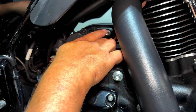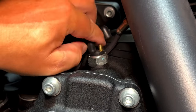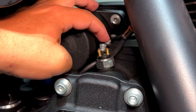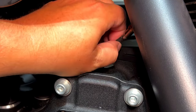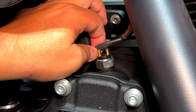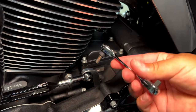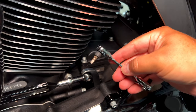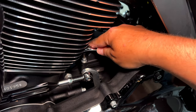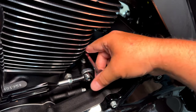In order to vent the cover from the transmission, you will have to disconnect these cables and that will give you access to the screw. There is also this cable from the sensor that I put kind of behind just for a clean look, so I will move that away. I will use this really tiny ratchet — like a 4-inch ratchet with a 3/16 — it will allow pretty easy access.